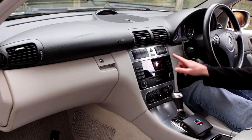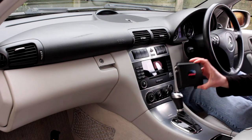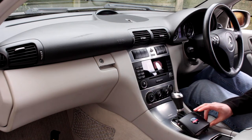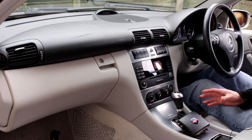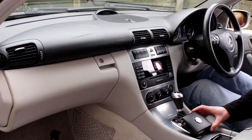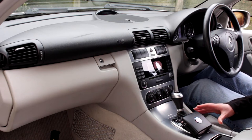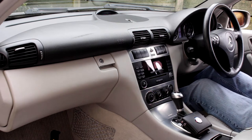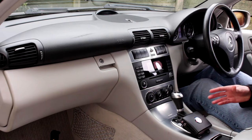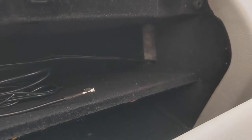There are no slots for removal keys on this radio, so we're going to have to take out some trim and find a place to install the Auto DAB device. We also need to install a DAB aerial, because the FM/AM aerial in this car isn't suitable for DAB. We're going to use a windscreen antenna — we've installed those before on the channel and there's a link above to that video. We'll skip ahead and bring the cable from the DAB aerial into the glove box, ready to use.